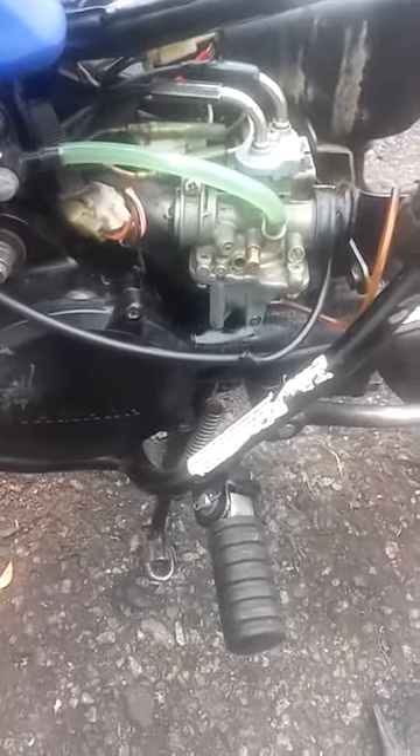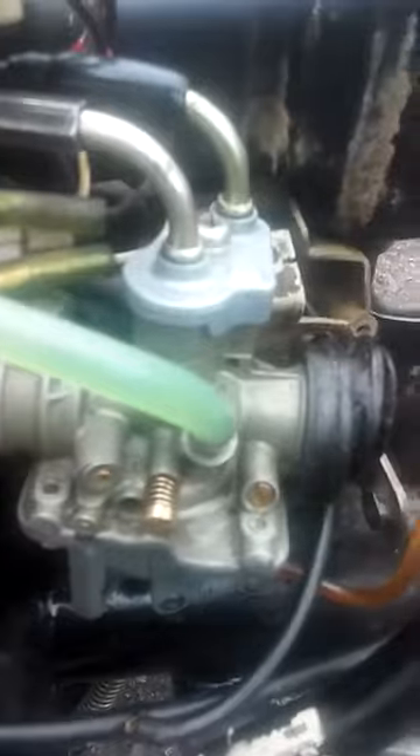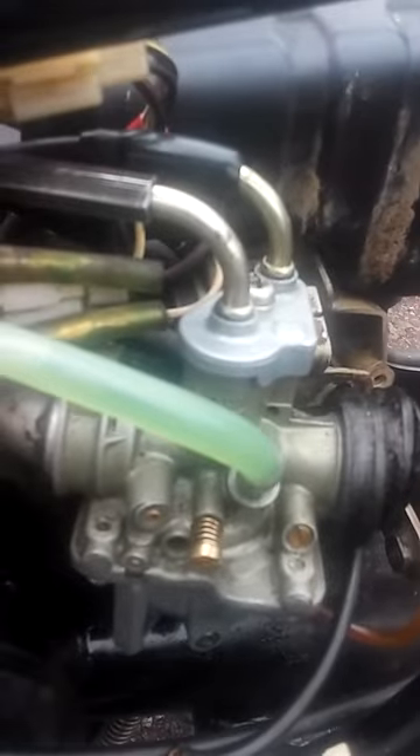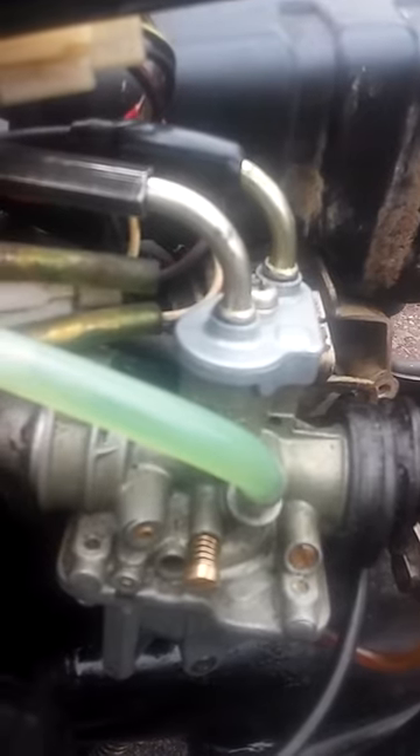It's not broken in yet, but we're having a problem with the throttle idling down. Going crazy with this throttle cable. Somebody put an aftermarket throttle cable on it — it wasn't letting the slide go all the way down to the idle position. It was still hanging up open a little tiny bit, giving it a higher idle than normal.